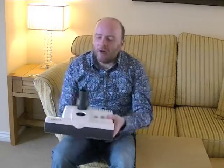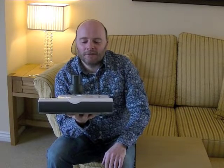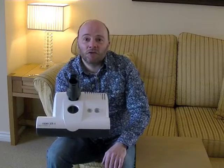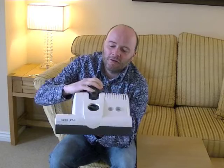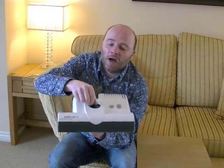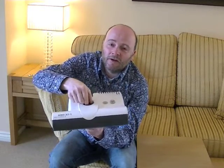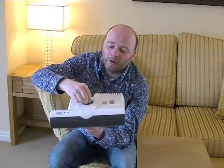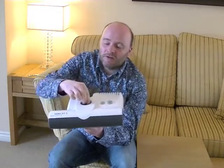Final thing to show you on this machine is the Sebo ET1 power head. This is the same power head you get supplied with the Felix upright cleaners, so it's basically the same. You get 4-position manual height control, none of this automatic nonsense with the Sebo X series. A lot of people like the automatic height control on a Sebo upright. I personally don't like it. I don't feel that it gets deep enough into the carpet. It just seems to skim the pile of the carpet from my experience. So I'd much rather have the option of adjusting the height control.